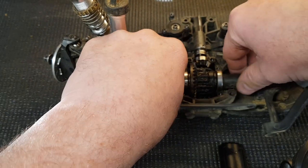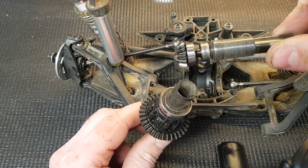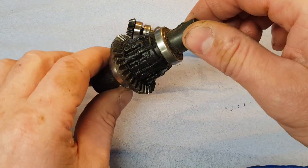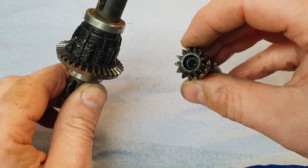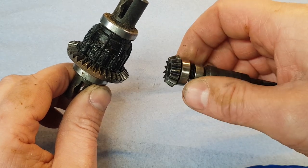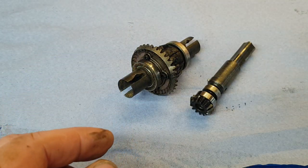Here is our differential and the pinion gear with the front axle on it. If you've got these out of your truck, the first thing to consider is why you've taken it to bits. If you've had some problems — some grinding sounds — you've probably worn this gear. We'll do a quick inspection: there are no dodgy noises from the gearing on the front, I can't see any evidence of damage to any of the teeth, and there's no sign of any metal filings inside the case.